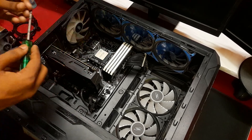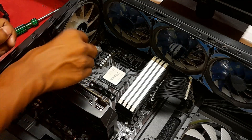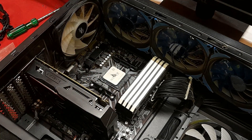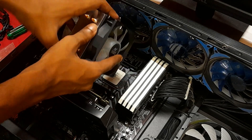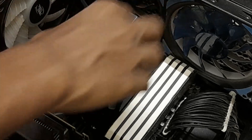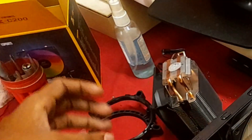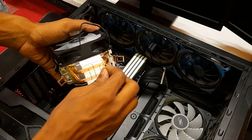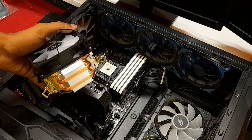Once the mounting bracket is installed, the next step is applying thermal paste. Thermal paste comes included with this CPU cooler, but if you have better quality paste you can use that instead — this one will easily last for a year, so you don't need to replace it for at least 12 months. After that, you can install the CPU cooler in place. But don't repeat the mistake I made — I actually forgot to remove the protective film from the cooler's base. So I reapplied the thermal paste; make sure you take that protective film off the base before installing.